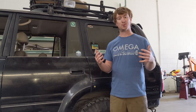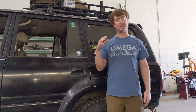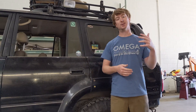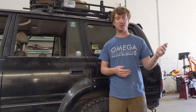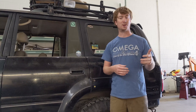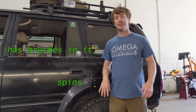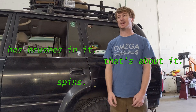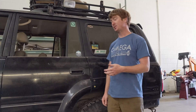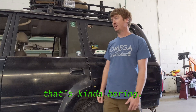If you're using a transfer case, you might as well use a single motor, because dual motors are great but if you can't actually use twice the power, then a single motor is just fine. I've been looking at all the different options. You could get a brushed DC motor — the kind everybody thinks of for a golf cart or an old RC car. It has brushes, it spins, and they're pretty cheap. You buy a controller and build yourself an electric vehicle. But that's kind of boring.